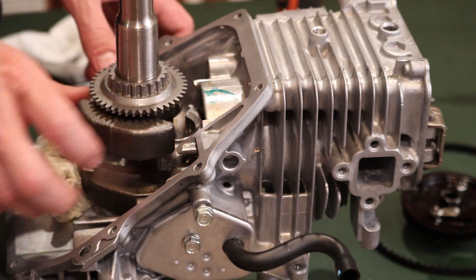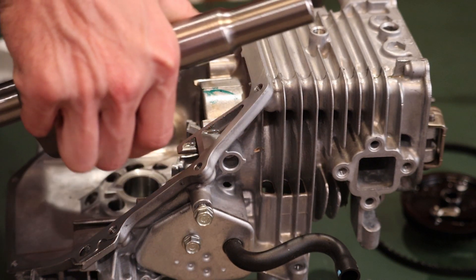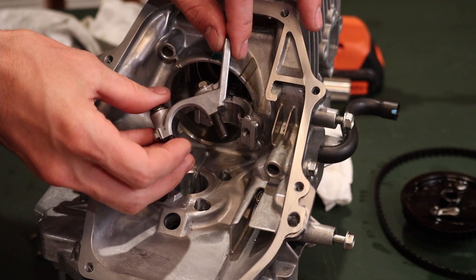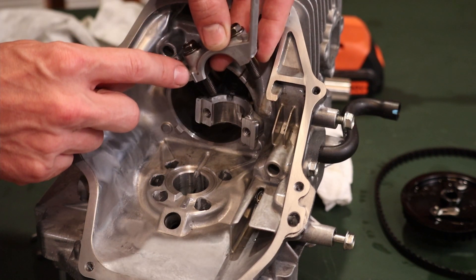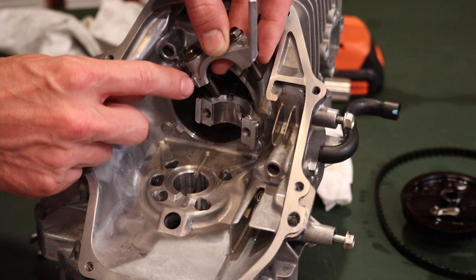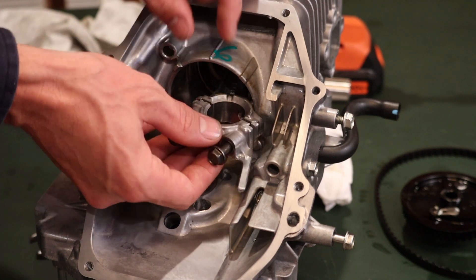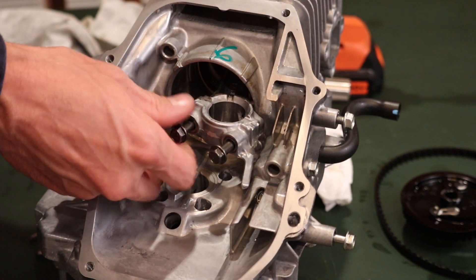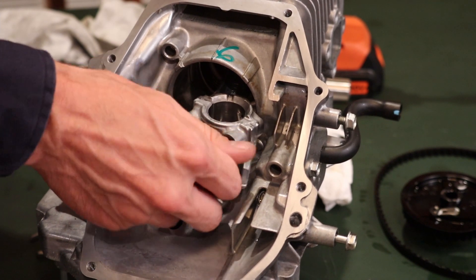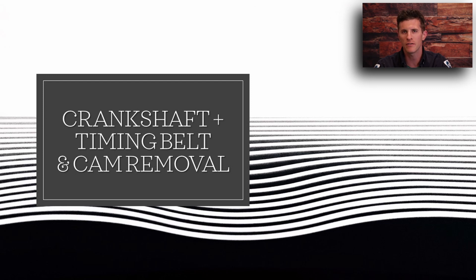We'll set the belt off to the side. At this point, we can simply rotate the crankshaft a little bit and pull it straight up to clear the connecting rod. Once that operation is complete, reinstall the rod cap back onto the connecting rod. You can see the index mark done as a line, with a matching line on the other side of the connecting rod. Snap the two pieces together, then manually run the bolts up just a little bit so they don't get lost. This has been a look at how to remove the crankshaft and index the rod cap in your Honda GC Series engine.